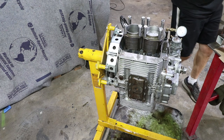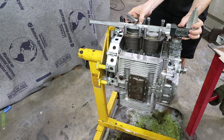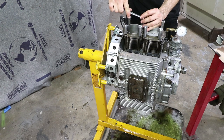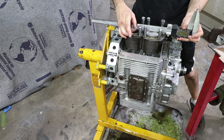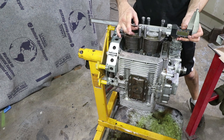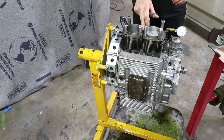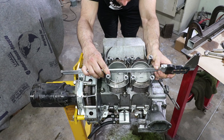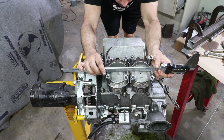That's way better. Let me get the long straight edge — yeah, I think that is perfect. I don't think I can get a feeler gauge in there, but it does go in on this side now, which is opposite. I'm going to torque a little more on this one and see if it really influences the measurement. Just that little bit of torque prevented this from going in, so I think I've done the best I can do. It's within two thousandths of an inch on this side and it's only going to get better when I seat this down with more pressure.